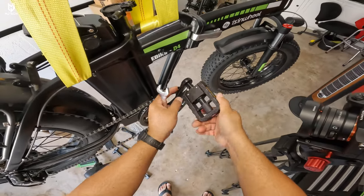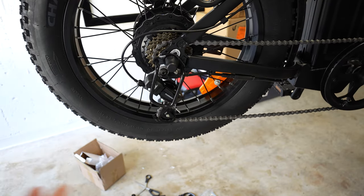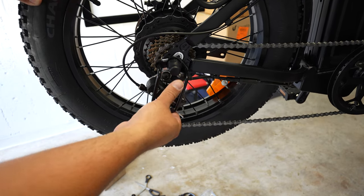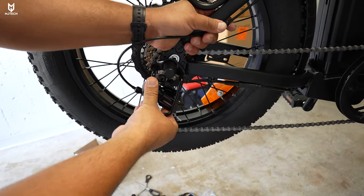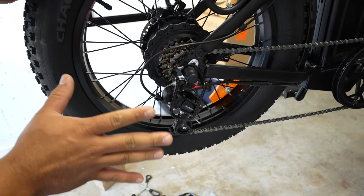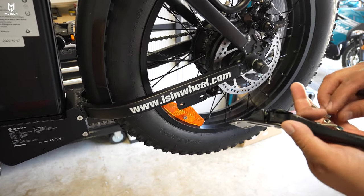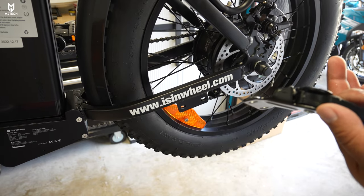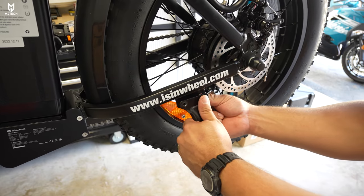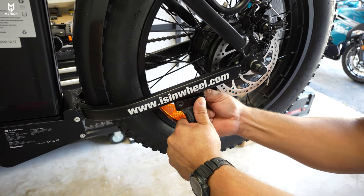A quick observation: this bike, like other electric bikes, comes with a derailleur protector during shipment. Sometimes it gets a little bent, so just pull it out slightly with your hands to give it free space so gears shift freely. Next step is mounting the kickstand — remove the 10 millimeter nut from the screw, no washers needed, place it into the frame, and pre-bolt it on the back.